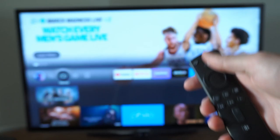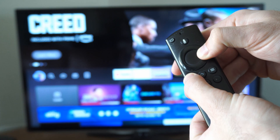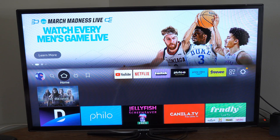The last thing you can try is factory resetting your Amazon Fire Stick, erasing all the data and starting it up like it's new. Hold down the back button and the right button for about 10 to 15 seconds. Eventually the screen will show up in the background and it will automatically initiate a factory reset after about 15 seconds. If you can't see the screen, it will automatically do this, and if it's a settings issue, this should fix it.